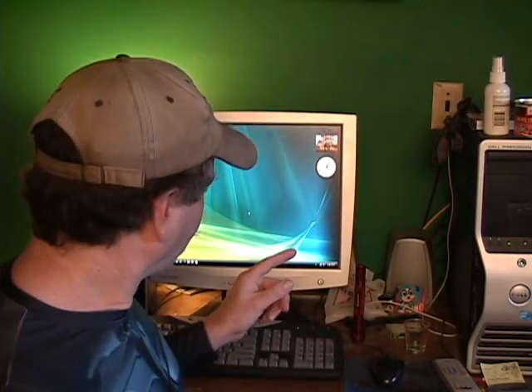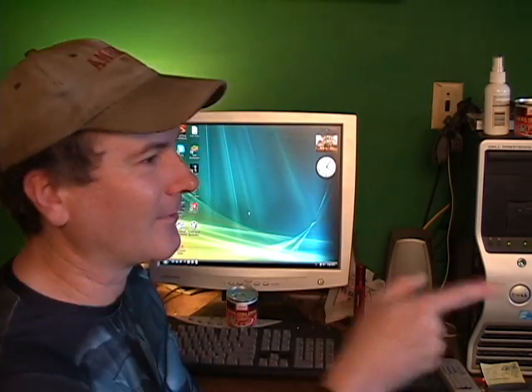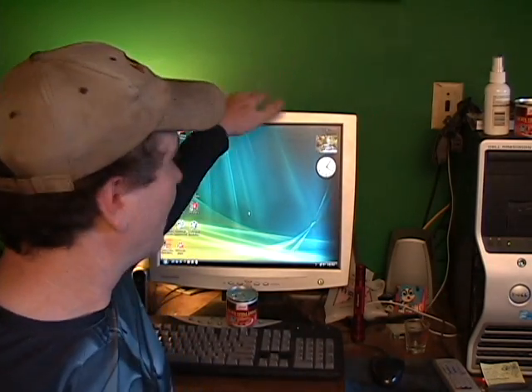So I started looking at the back of my monitor and at the connection back there. I noticed lo and behold it also has a VGA connection. So I put the 15-inch CRT back and put my monitor back — it worked. For a while. Until it went into sleep mode. I kept troubleshooting: the computer would come out of sleep mode but the monitor would not.